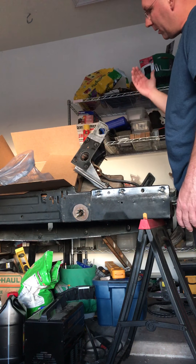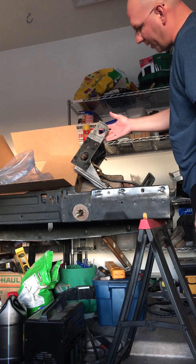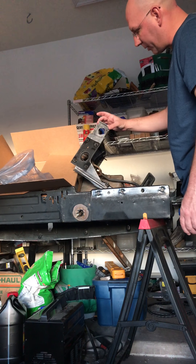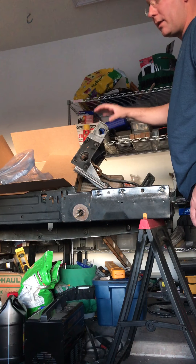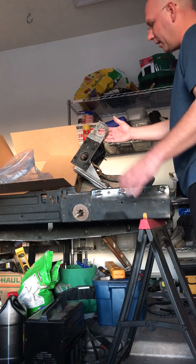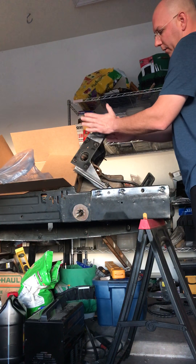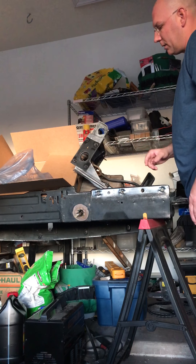That being said, I only need about this much of it. So basically I cut this off, mold this into my truck, and I'll be able to get all the clutch to adapt pretty easily. I'm just gonna end up bolting this little piece right here into the firewall of my truck on the inside rather than the outside, and I'll still get the same distance I need where the clutch master cylinder comes in.